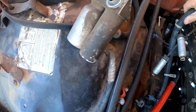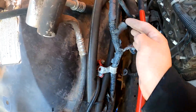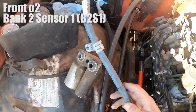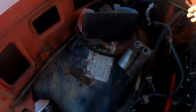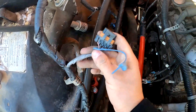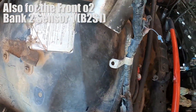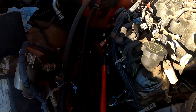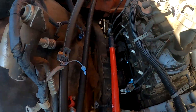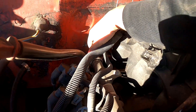On the left side of the intake we're going to follow this one down — it may already be partially unplugged. Following it down it goes to our O2 sensors, which are a four-pin square plug. This one I don't exactly remember where it went — this engine's already been moved into a new vehicle so some of this stuff has already been unplugged, but I figured I'd just go through it with you guys.